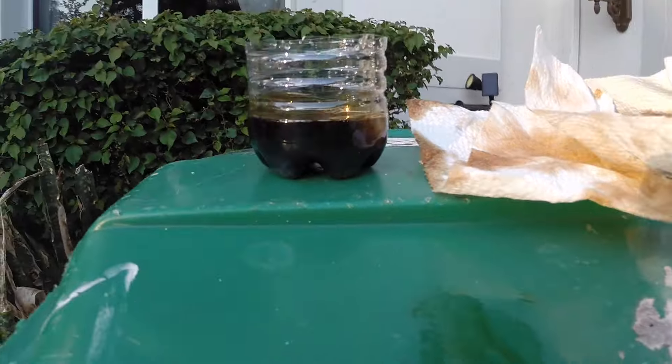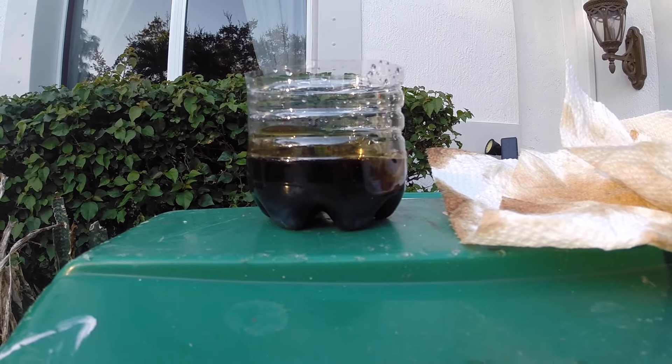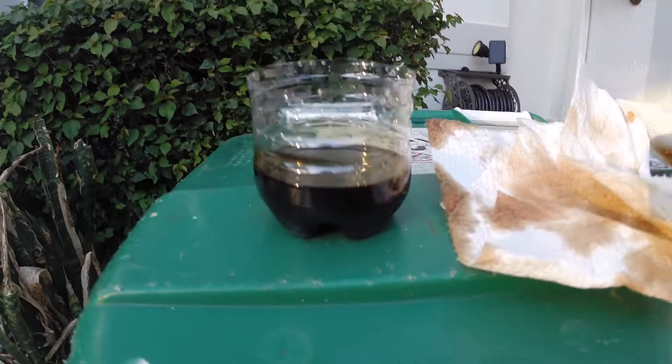That's a pretty significant amount — that's the bottom of a water bottle. I wouldn't want that much goop going through my intake manifold. It can get really gooey in there. The manifolds are often plastic, and while they're meant to handle petroleum-based products, a petroleum-based product may eat away at that or at least gunk it up. And if that gets into the valves or the intakes, it can cause problems.